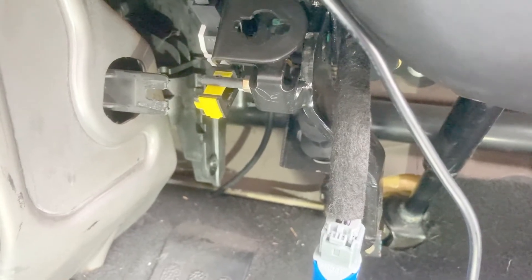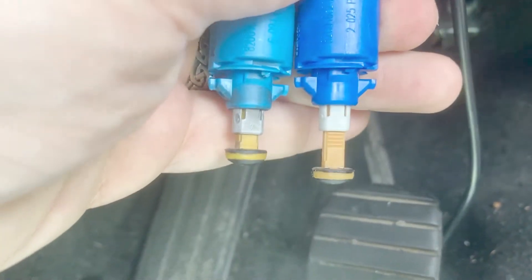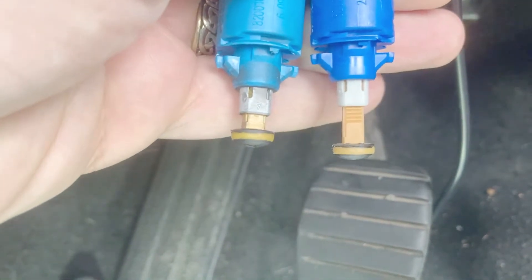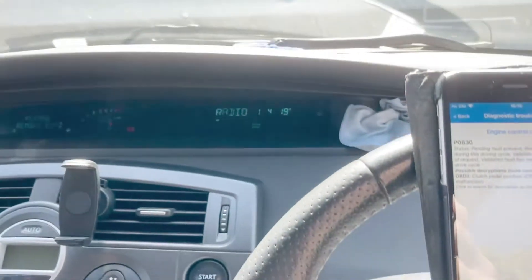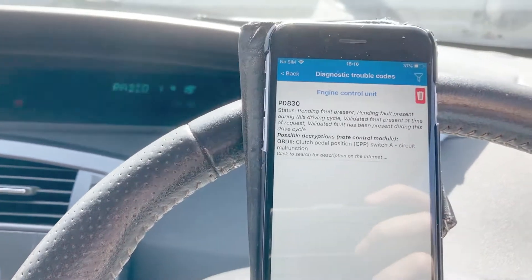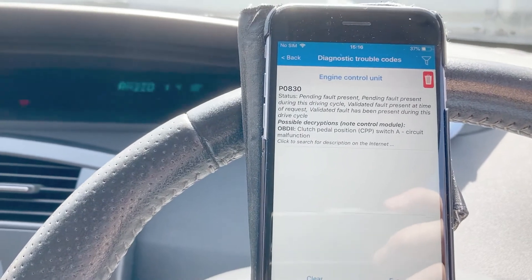I cleaned up the position sensor and put it back in, did the switch at the back, and was fitting the new switch at the front when I realised I hadn't actually compared them. When I did, I thought this might be the problem — though it should only be affecting the cruise control. Hopefully this will do the trick. Despite what this is telling me it was the clutch switch — I've replaced that now, cleaned the position sensor, put it all back together, and it's still not right. It went into limp mode again going up a hill into a multi-story, and I had to reverse all the way back, forcing everyone out of my way — a little bit embarrassing.